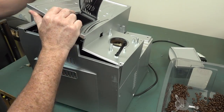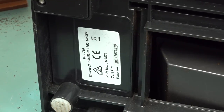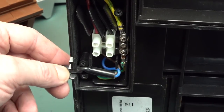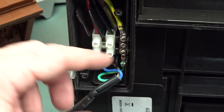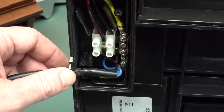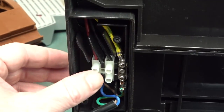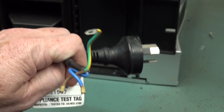I can start to see some interesting stuff in here. Zero number for those playing along at home. I was going to say 1,200 to 1,400 watts to grind coffee — what is this, the Juicero of coffee machines? No, I presume it's got a heater in there to make it hot. There's our mains input. They've gone to a fair bit of effort — a nice clamp on the input, a proper block with properly crimped mains earth connection, and little wire guides for the active and neutral into the terminal block. That's pretty nice. First thing salvaged: a perfectly good mains lead.